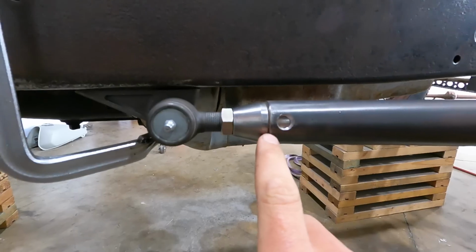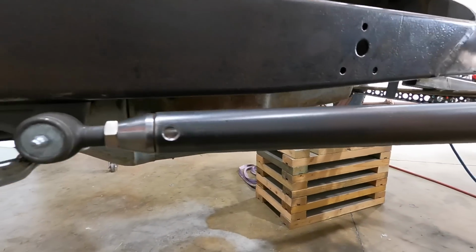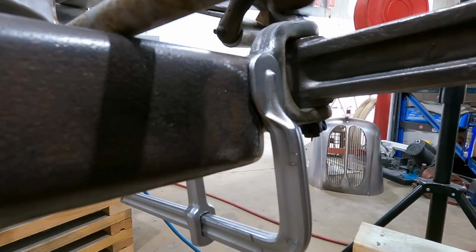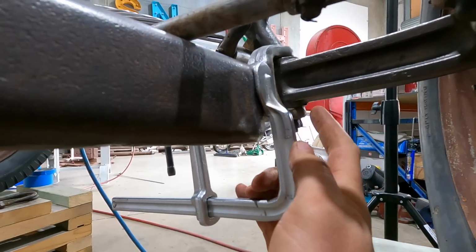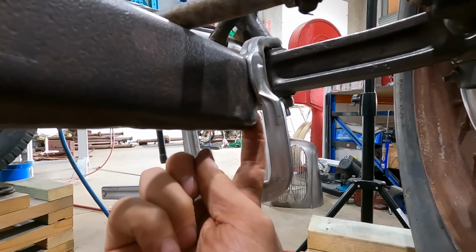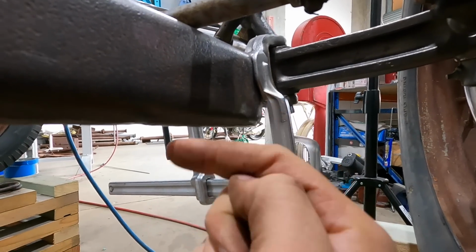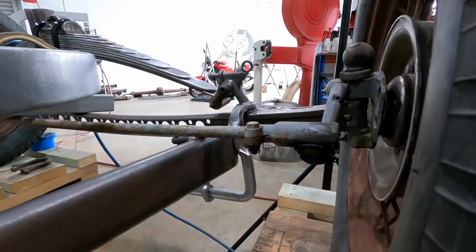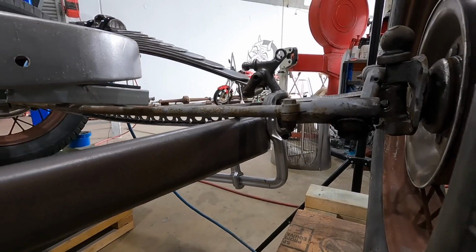And then I have beveled the edge. We've drilled a few holes on both sides for a nice rosette weld. And then basically this travels down and then meets up to the Model A, what would you call it? Wishbone end that goes to the axle. So there is a considerable difference between the size. So I will probably pie cut this and just move it up so it kind of flows into the bottom of that. And then what we will run into is drag link. I will have to bring this down underneath here, which is doable.